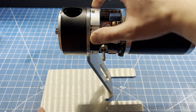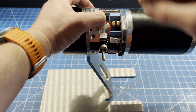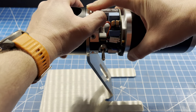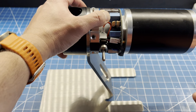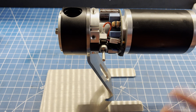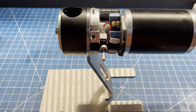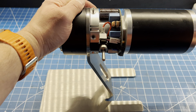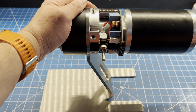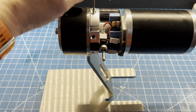The five radial screws may not always align perfectly with the holes. Three of the screws are mandatory and two are optional — usually one of the two on the bottom doesn't fit perfectly. When we assemble these grinders, we sometimes have to remachine the holes to make sure everything fits. If you're reassembling with a spare motor we've provided and all the screws don't fit perfectly, that's fine — you can assemble with one or even two fewer screws.